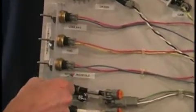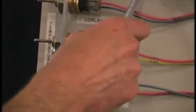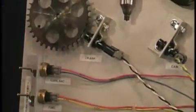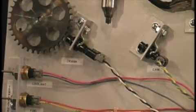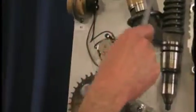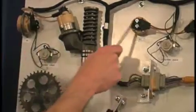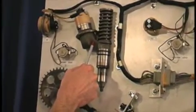Moving up, you can see that I've got coolant, fuel, and intake manifold temperature sensors and they are sensing ambient air temperature, which does not change. I also have crankshaft and camshaft position sensors. The crankshaft position sensor is actually attached to a motor on the backside of the board, and this is how I simulate the engine running. There is a cam sensor but no cam wheel — it was too difficult to make that work, and it works just fine the way it is. On the top of the board are six injectors; there's only one real injector — for weight savings I only put solenoids on the other five. This injector actually clicks and it does work. Between each pair of injectors are the Jake brake solenoids.